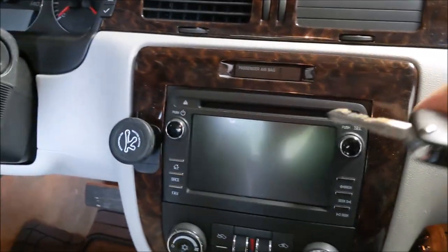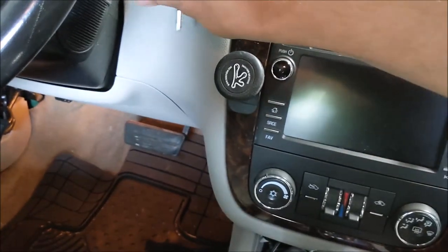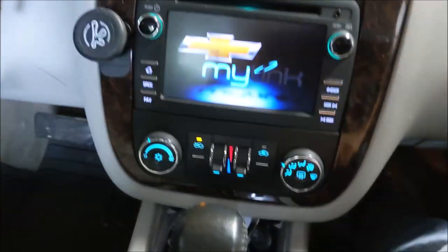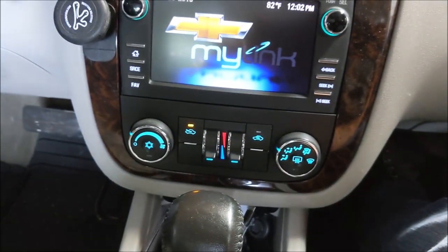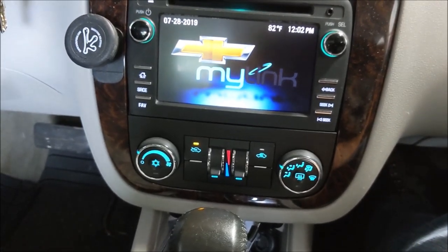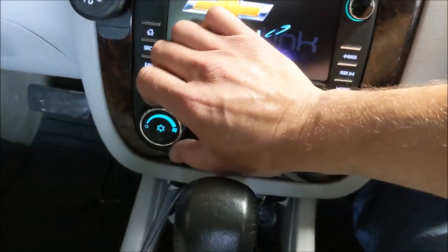What we have for you today — I'm having some trouble on my '12 Impala. It's not really going to do it now since the car's been sitting overnight. What's happening is after I've been driving for 25, 30 minutes, I'll stop on the way home, get my mail, whatever, get back in the car, and the blower fan doesn't kick on. I can turn the damn thing and it doesn't do anything. So what I've been doing is coming over to the passenger side and giving a little kick right there, and then she suddenly springs back to life.